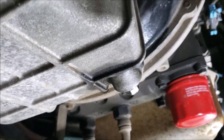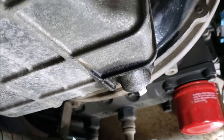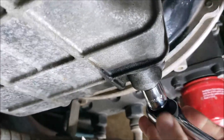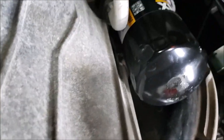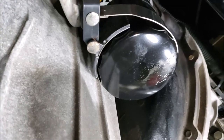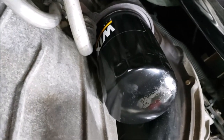Under here in a tight spot — there's the drain plug, 15 millimeter socket. I haven't run the engine yet, but before I get it cranking hot I always like to crack it loose so I don't have to struggle with it once I'm back under here fighting the heat. I already cracked it loose earlier so I'll put it snug. Then of course I take the oil filter wrench and break it loose — still got my nice big Wix filter on there. It's pretty snug, but that way I know when I get back under here everything's good and hot and I can get that off relatively easy.